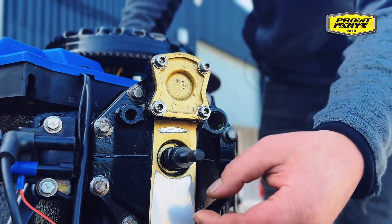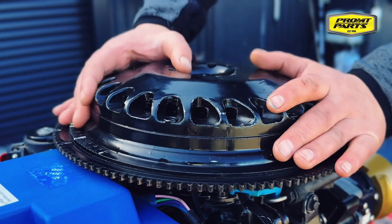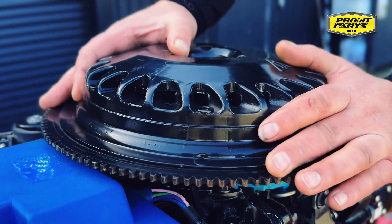Locked there — lock the tool — then turn the flywheel around nice and gently until it touches on the piston on the other side, which would be before top dead center.